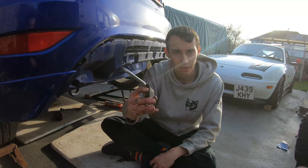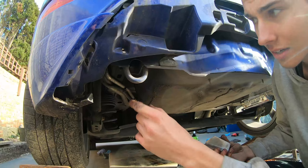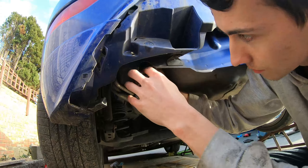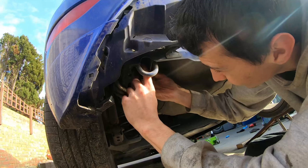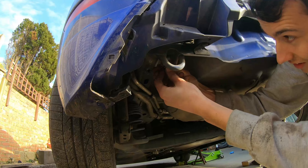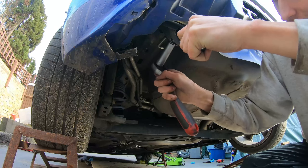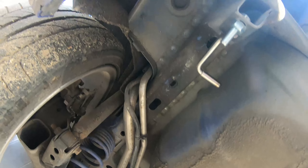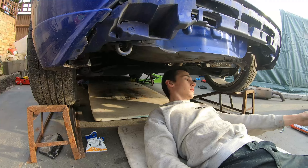You need your exhaust hanger for the left hand side of the car — obviously the car doesn't have one standard, so you get a nice little bracket that's all supplied with the kit. You want to use this point here. When you've got the bumper off it's the best time to do it. Slide the bolt through — you don't want to slide this in like so. Then put the bolt and washer and hanger on the other side, right up in there. That is your hanger on.